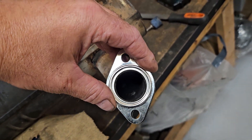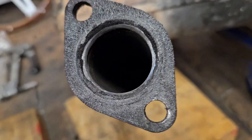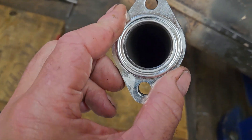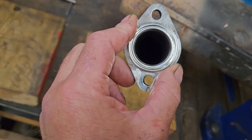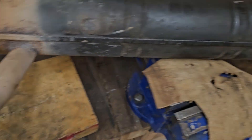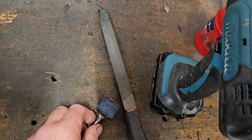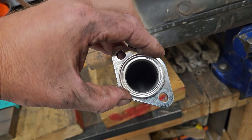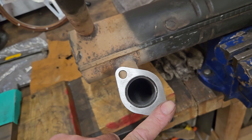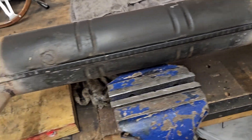I've removed quite a lot of material — it was in the way on both sides. I used a hand file, a tungsten carbide bit on the drill, and a barrel sander on the drill. There's a little bit more to do at the top on one side. Port matching on the exhaust is finished. I've also cleaned up the face here with a nice flat block and heavy-duty sandpaper — done that on both sides. This is now ready to get bolted onto the engine.